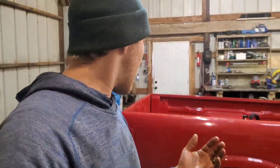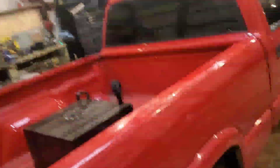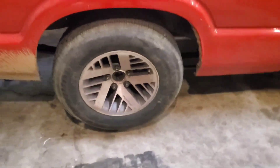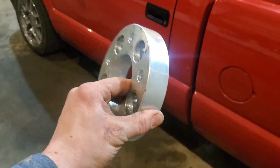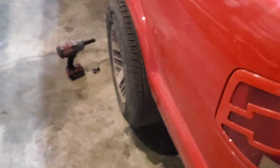Unless you're getting new wheels, you can just get Ford bolt pattern for the back and GM bolt pattern for the front, which can be kind of a hassle depending on what you're doing with it. But I'm going to re-drill mine just so I have the same bolt pattern all the way around. I have this side drilled already as you guys can see — it kind of sits flush with the bed. These are old Firebird wheels. Up front I have Corvette wheels. This side is not re-drilled yet. I have a Ford to GM bolt pattern adapter on here — it's like an inch and a quarter thick. That's why the wheels stick out, and that is why I am re-drilling these.